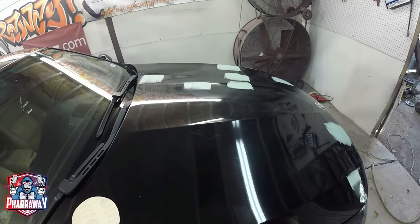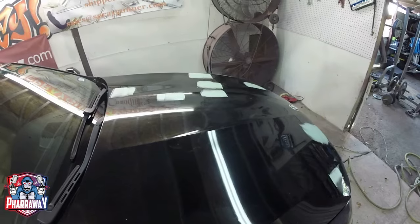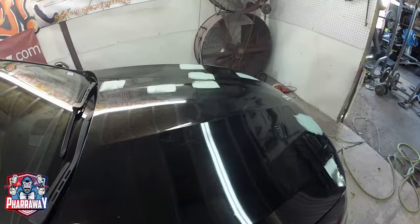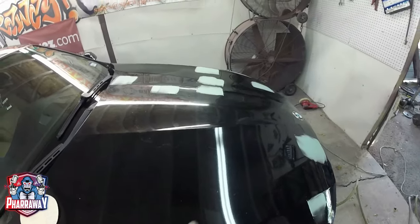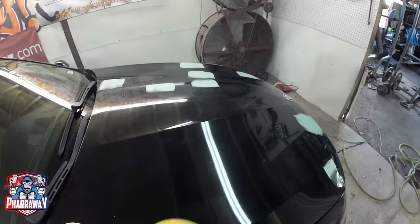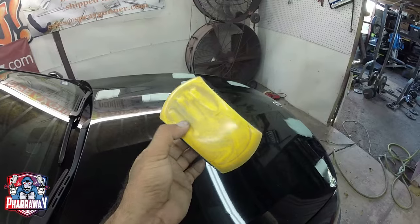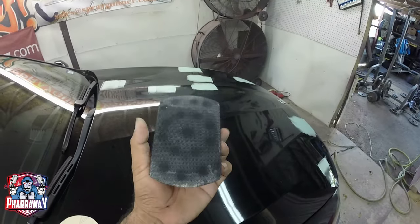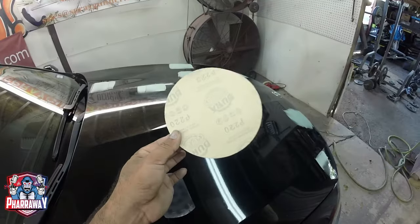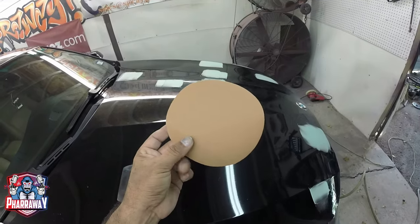There's a real simple trick to get those little small dents real flat and for the body filler to stay just in that area — not all around where you applied it. What do you use? I'm going to use this. This is a block, but it's velcro, and you can install one of these DA sandpapers on it.